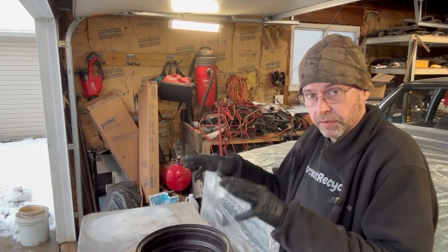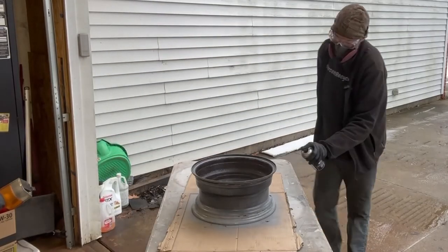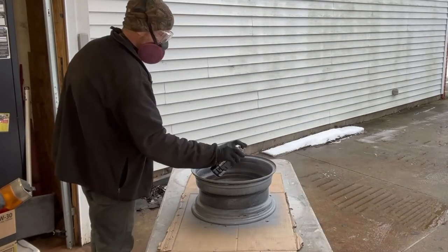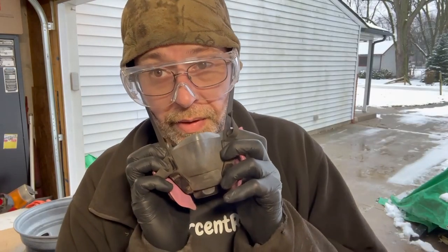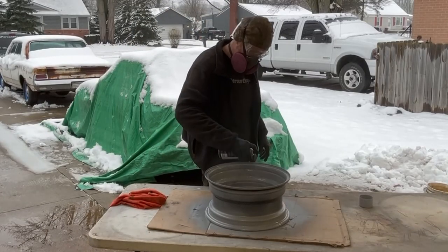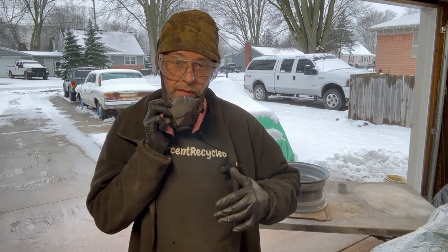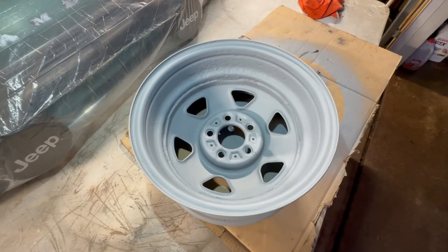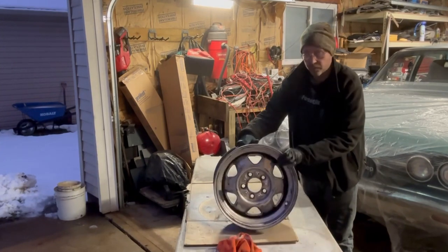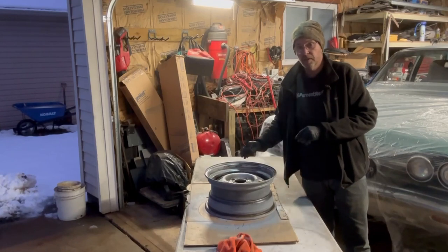It's been snowing for about 10 hours so I'm going to do this quick, in and out. This is not the proper way to paint — the weather's not right, the humidity's not right — but it's what I've got time for. I'm going to close the garage door with clean coats to give it the best chance to stick. I'm just going to put two coats of primer on the inner barrel and the wheel surface on the back side — that'll be good enough. I moved it on the cardboard so the paint doesn't set and stick to it. The inner face of the wheel is done, so I'll flip it over and get the front side. I'll hit a couple of bad spots with etching primer, then give the whole face a coat of primer, let it dry, and tomorrow give it a top coat — probably three top coats.